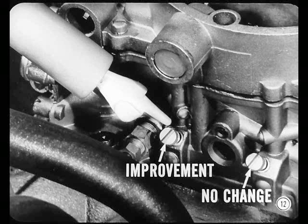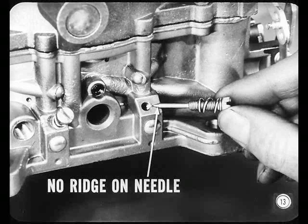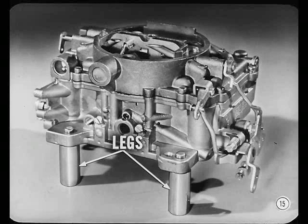Well, maybe that one needle's damaged. All right, check that, Tech. No ridge on the idle needle, not even a mark. And you can see that the choke is working okay. Did you try taking the air horn off? Nope. I'm not sure how this carburetor's made inside. Then we'll start there, Nate. So disconnect the choke and throttle linkages, then take off the carburetor.